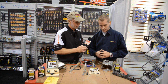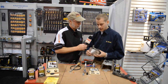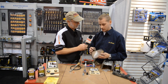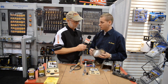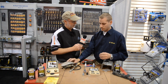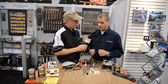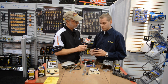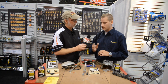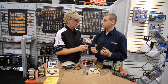We use a valve cover just as an example for metal, but oil pans, radiators. I have this headlight here — headlight tabs always shear off when you get fender benders, and people really use this in the body industry to repair headlight tabs. Straight away you're back on your way. The same method is using the liquid and the powder to bond together. Just a quick tip: when putting two pieces together, you want to get it as dry and clean as possible. You glue one side, put the two pieces back, and if you want to reinforce it with the powder, grind over where it was cracked just a little so you have somewhere to put the powder, and layer the powder in that grind. That gives it more surface area to grab onto, just like welding.